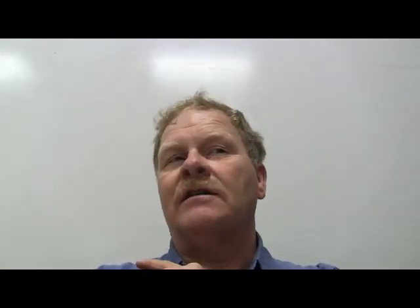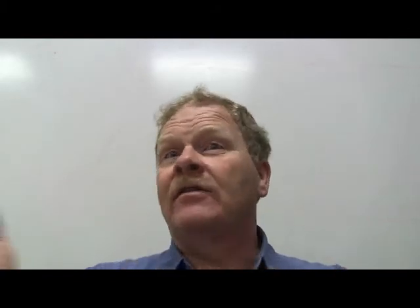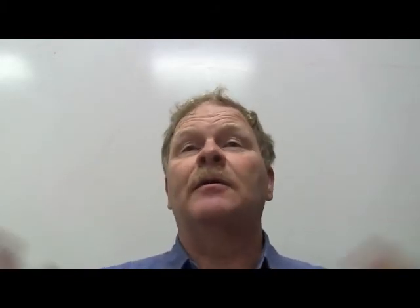Speedometer's reading too fast, right? Well, we used to have to do this all the time, guys. Somebody comes in, my speedometer's inaccurate. Well, your scan tool ain't going to help you with that, is it? You know what I mean? You better come up with some kind of way to make this work. However, whenever you drive it, you can actually go in here and change the tire size and the axle ratio and all that on your scan tool to recalibrate it. You can check and see.